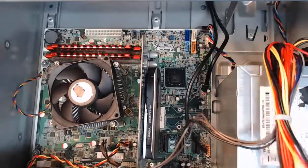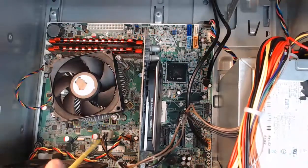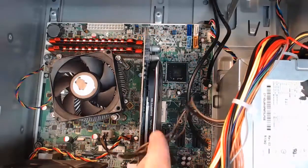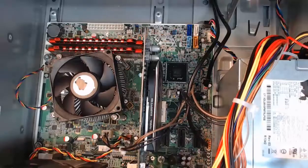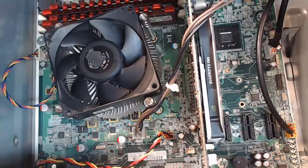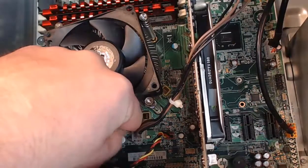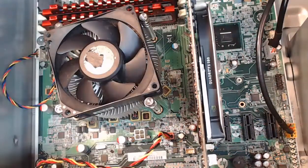We're not done yet, because if we take a closer look inside this case, we see there's this other ATX CPU power connector. You may not have this on the board — it really does depend on your computer. This one also has a little lever. It's a four-pin right there, and we see it's got that little clip on it as well. I'm going to reach my hand in there, put my thumb on that lever, and pull straight up. That's the four-pin ATX CPU power connector — it gives extra power to the board for our components. We're good on the power disconnects.